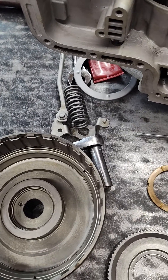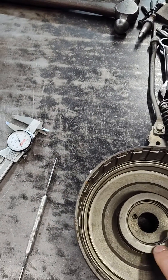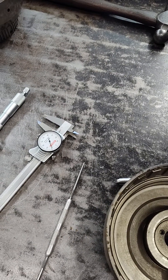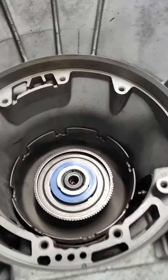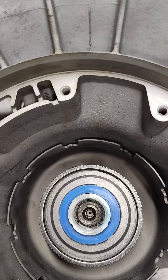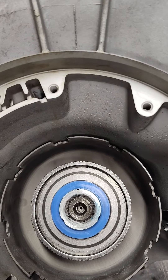So just a couple of things on that gear set I wanted to point out, and to show you that new spacer so you can use either drum. Before you order this kit from us, double-check which drum you have. If it's the 0.400 depth, that's the 76 and up. If it's the 0.330 deep pocket, that's 75 and older — and if you get the 75 and older kit, it's going to come with this little blue washer. It can't be simpler to install — just put that in there and you're all set. No need to spend $100 on a new drum. Hope that helps you out, and we'll see you on the next one. Thanks.